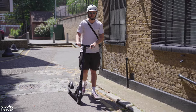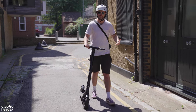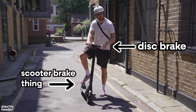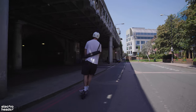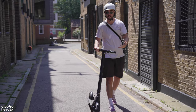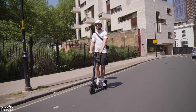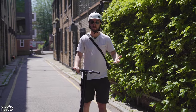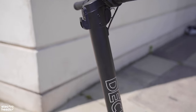Now let's discuss the downsides of the Decent X7, because there are one or two things I'm not so crazy about. The main one is the lack of any regenerative braking — I've never seen a scooter that doesn't have it. We've got the classic disc brake and the classic scooter brake at the back, but there's no regen brake to recharge the battery under braking. My guess is they've omitted that feature to keep the price down. The knock-on effect is fairly underwhelming range: it's claimed to be a 15-mile range scooter, but I've personally been seeing about half of that. I'm big and heavy and I ride quickly — but range doesn't matter that much when you've got swappable batteries.